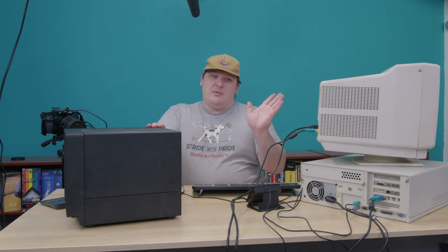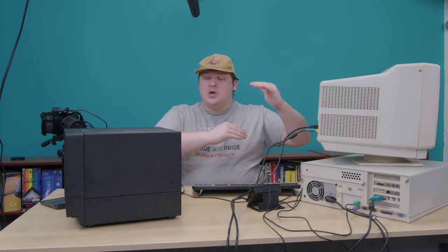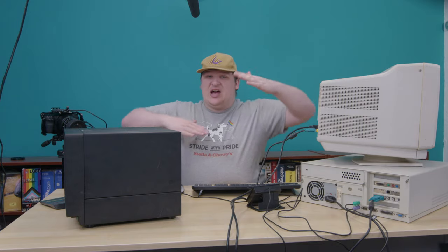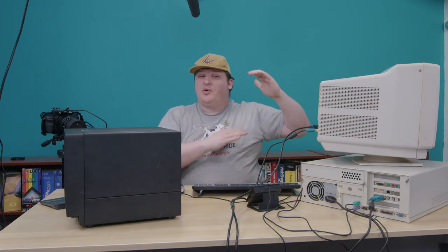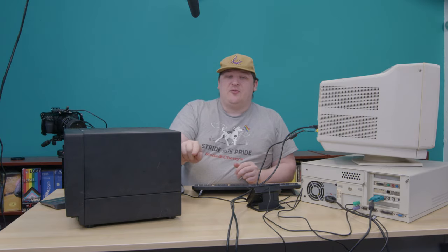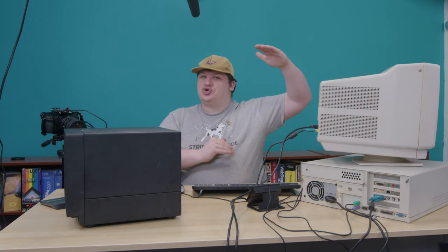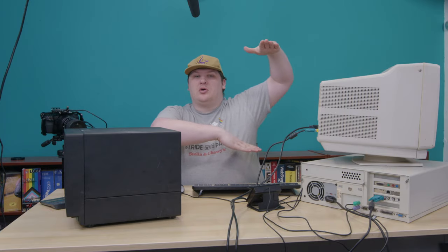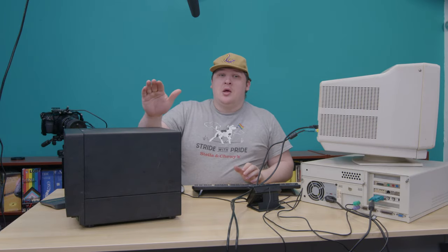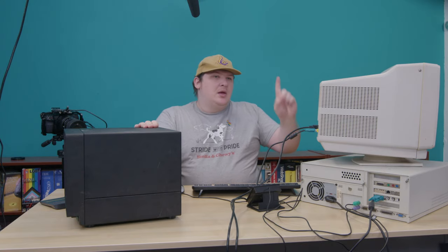Well, you noticed, maybe you did, maybe you didn't, on this monitor, when I flipped that switch, it changed size. Because when I took it off auto, auto was sizing the screen based on the sync pulse direction, which was 320 by 200. But when I flipped it to 64 color mode, it goes, oh, 64 colors, you must be using EGA enhanced. And it automatically shrunk the screen so that the larger, longer raster would fit. This is desired behavior if you're not trying to use a game that's doing this hacky, unofficial mode stuff, right?